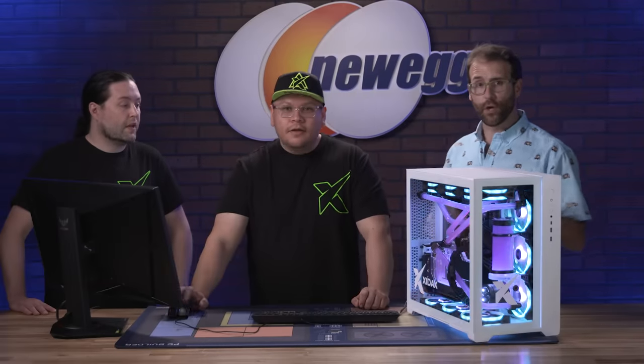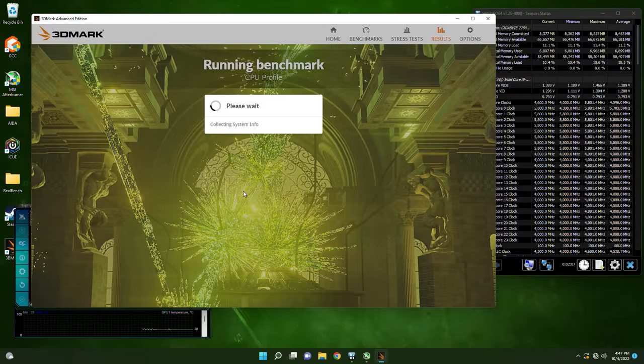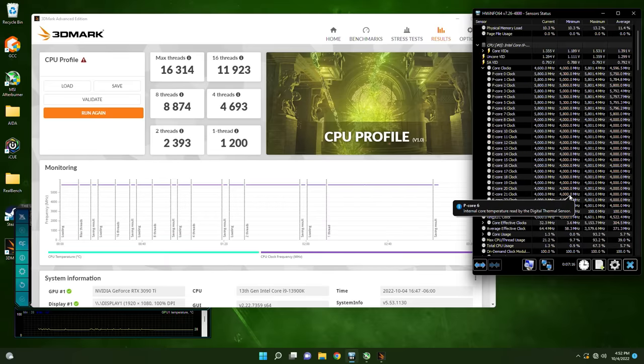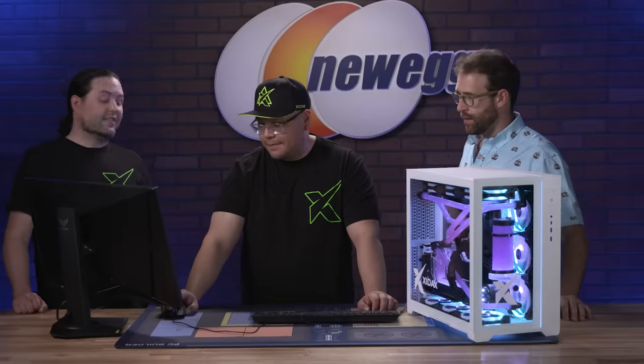A few moments later — this is literally overclocking. We're going to do a CPU-only benchmark. We're at 5.8 — a little bit of a step up from 5.5. Here you can see the effects of the delidding: we're currently running at 30°C idle, normally 23 to 30°C idle. Your max hit 84°C, which normally you would never see on anything. We're pushing it beyond where it would normally go — safely, still. This is an example of a great overclock: it's stable, it's cool-running, it's beautiful. We're gonna go farther.